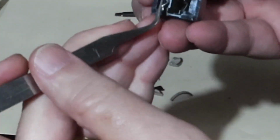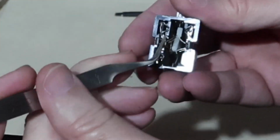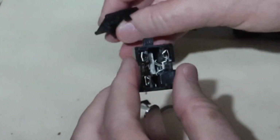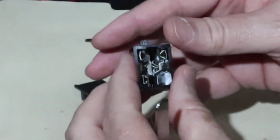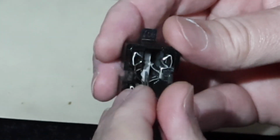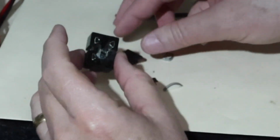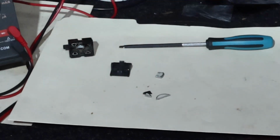So you can see this contact here goes straight across here to this blade. So there doesn't seem to be any resistance change between that post and the one that's marked motor, if I remember right. Right, motor. But then to get from this one to this one, it goes through the semiconductor, right? And this is for the starter pin. So this changes its resistance with voltage and current going through it, with temperature, because what it does is it heats up.